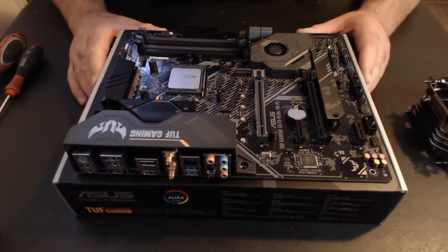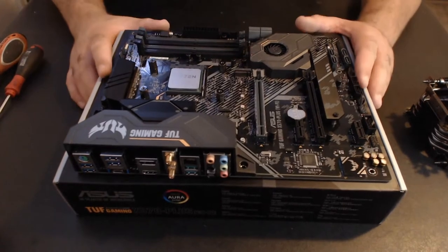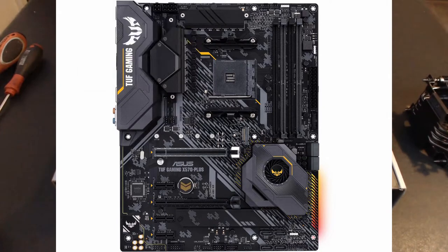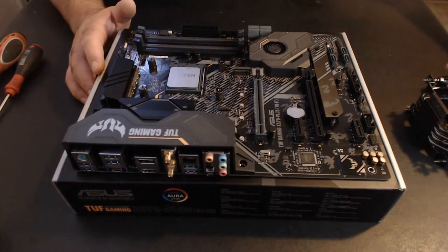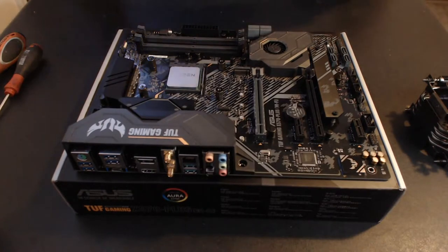All right, CPU's in. Now let's put the CPU cooler. Now, can you see? Yes. I did cheat beforehand. This came with a bracket here and here. I removed it, I installed the AM bracket, AM4, AM3 bracket. This way the fan will just go right in. Here she is.